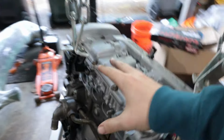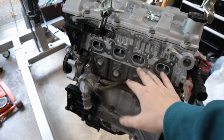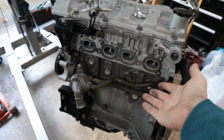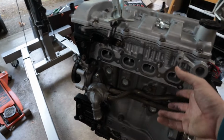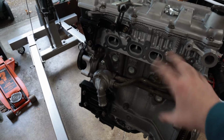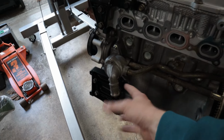We were just looking at the engine setup. If we don't clock it, it is going to add probably 6 to 8 inches worth of extra tubing because the compressor outlet goes up, and we need to route it over this direction. Whereas if we clock it down, it may make the tubing shorter, but also it's gonna interfere with the lower radiator hose connection for this.